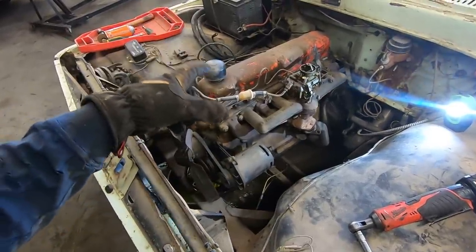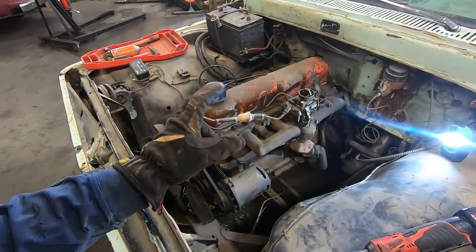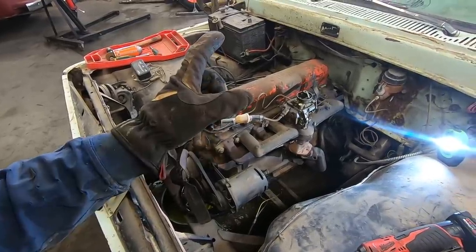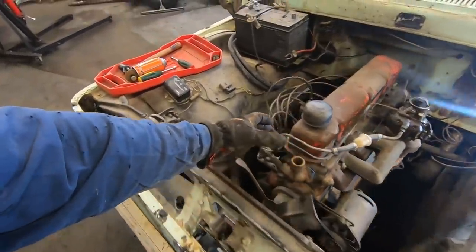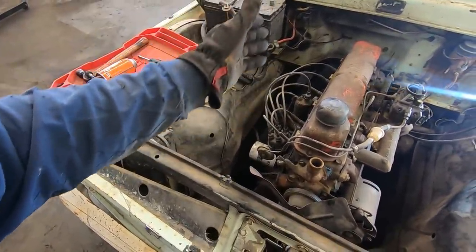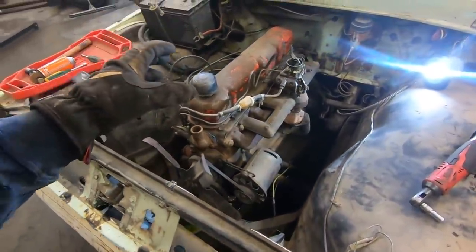Oh yeah, that's it. This is a 223. The way I can tell, a 215 was kind of a one-year-only deal in '53. That's what the '53 F100 had. And the 223, the carburetor and exhaust is on this side. And then your later 200s, 240s, 300s is all on this side. And nothing freaking interchanges between the two of them because Ford things.